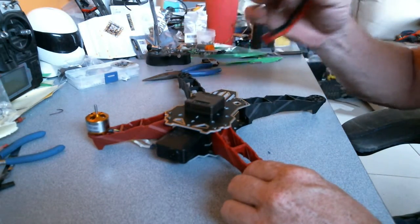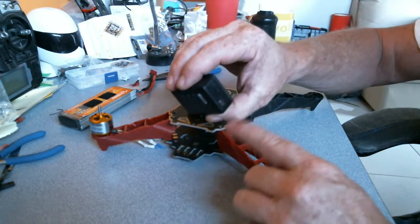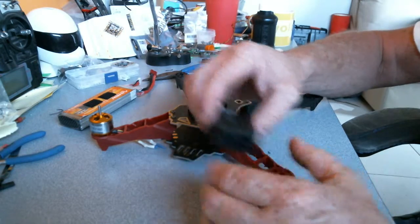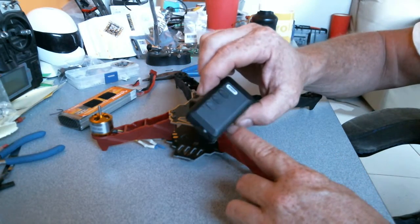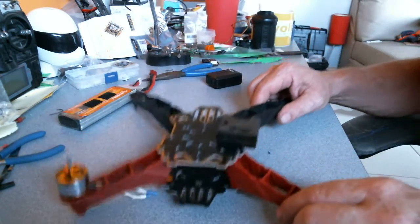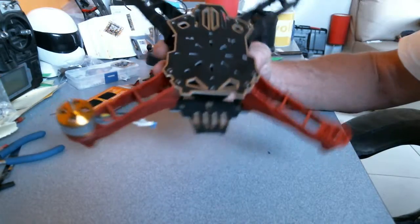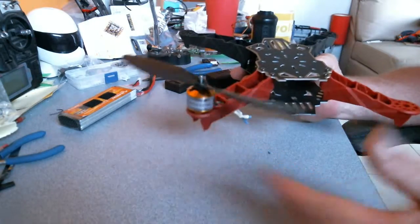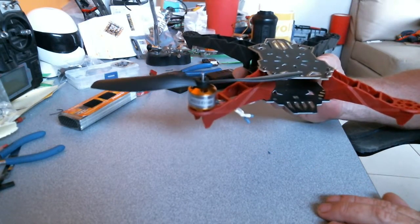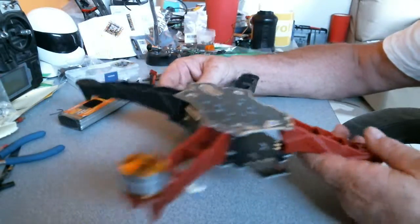3000 milliampere battery with it, and an action sports cam that has your 5 volt power straight off and your video straight off on one of the Mobiuses or derivatives of, and fly with it. So it's not your super duper race through the trees 330, but it would definitely be a craft that could fly 8-inch props. Okay, you could fly 8-inch props, 3000 milliampere batteries, still nice and light, able to go anywhere that you want, throw it in the car.